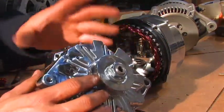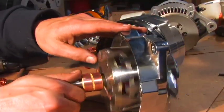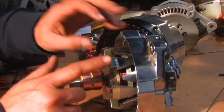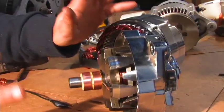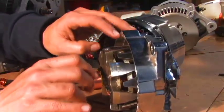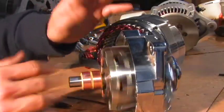The alternators don't have clutches that go on and off — if they did, they'd wear out really fast. So what car companies do is they make this an electromagnet. By increasing the current that goes to these poles, you increase or decrease the magnetic field. With no load on the alternator and no magnetic field excited in the rotor, these spin almost freely. If they are new and have a good bearing, they don't put any load on your car at all.